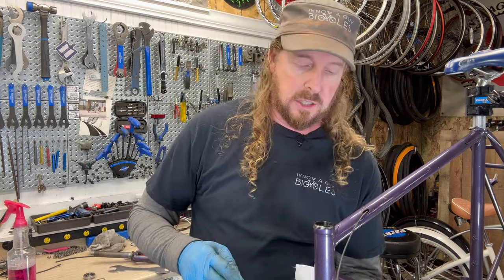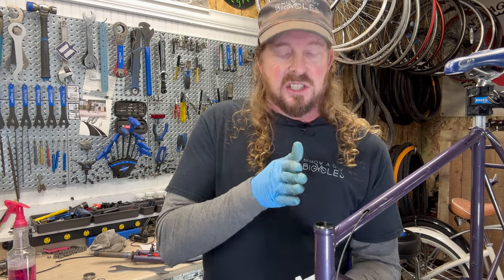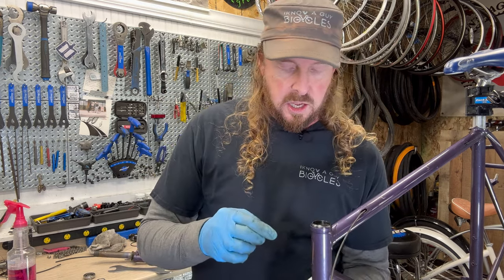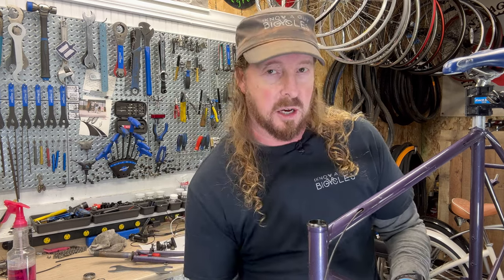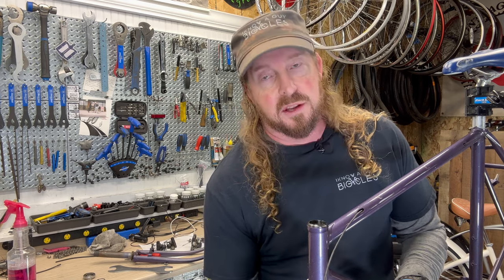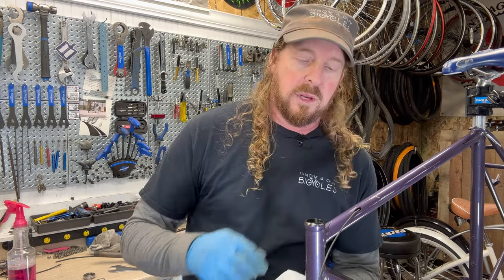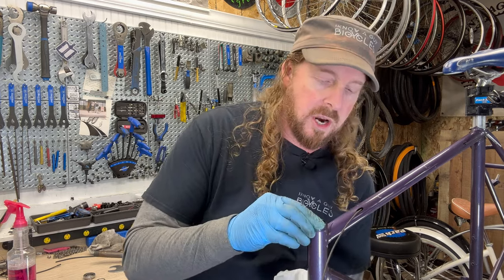Why would there be pits? Because the ball bearings are kind of stationary in one spot. So you hit those bumps or whatever, and it just kind of pokes at these races. Well, the problem is they don't move around like a hub or a crank set. So therefore it dings it up. The newer ones are those cartridge bearings, which have been a game changer. Makes it a little bit easier and smoother. You don't have to repack them. You can just switch out those cartridge bearings.